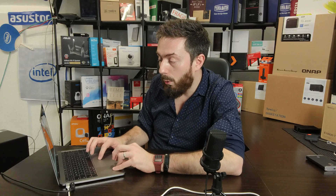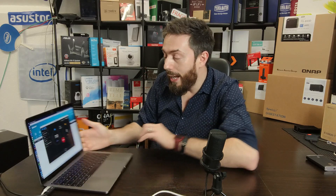We're going to the final test — the NVMe pool. Let's come out of AJA again and go for it. Hopefully the sound's still okay with the mic repositioned. Bear in mind this is a two-NVMe pool and it's not utilizing the QM2 card that's inside — which was utilizing four SSDs. We're going to go for the biggest one — a 5K Red 64 GB test file. Expect that dip in write that we've seen before. Let's go ahead and click.